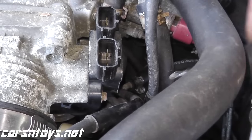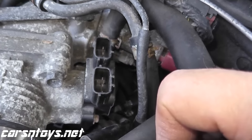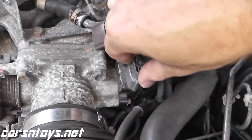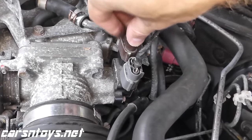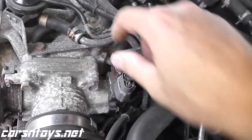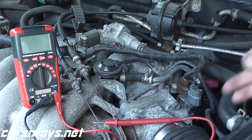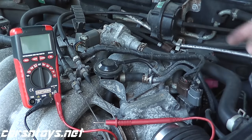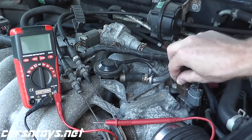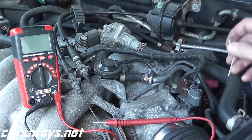You don't want to over-tighten these screws just yet, because we'll need to move this sensor back and forth to find the sweet spot for the idle. I'll show you two ways on how you can do that. Go ahead and reconnect the harness connectors and reconnect the negative terminal on the battery. Before we tighten down these two screws on the sensor, we need to adjust it — by rotating this sensor, it affects the idle speed. Number one is adjusting the sensor before we even start the car, and to do that you need a multimeter. I'll show you that first step right now.